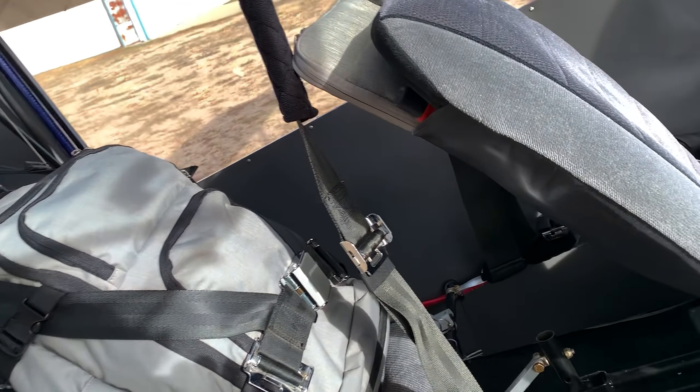Here you can see it — this turbine wheel is just all chewed up. It's amazing what happens — these don't hold up well when foreign objects get sent through. My EGTs are like 1,480 max in cruise — that's the highest I've ever been. I've tuned it rich enough that I'm in the high 1,300s or up around 1,400 wide open. Not running super high temperatures. To have that probe break off is just pretty ridiculous — it hasn't seen that extreme of heat, it wasn't very old. Really just an unfortunate, stupid thing to have happen. No more MGL probes for me — I am officially done running those.